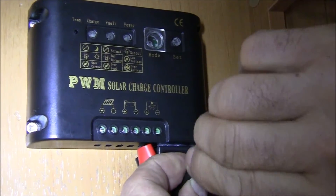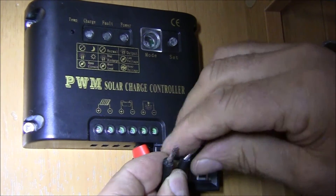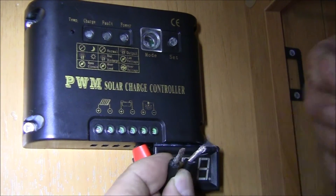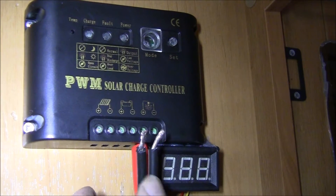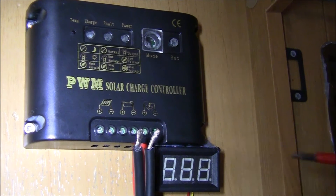Just clean them up. Make sure you do disconnect these from the battery, because if they touch they will cause havoc — you will have a fire. There's no two ways about it. Especially if they're connected to the batteries, which are 12 volts, and I've got two in parallel — you will be in trouble. So please disconnect your batteries.